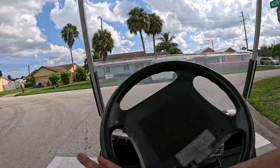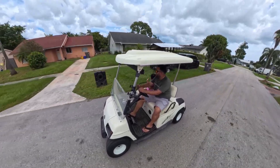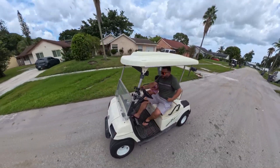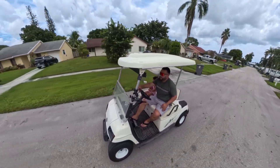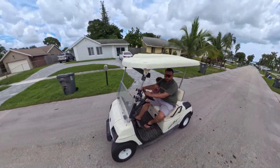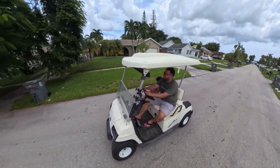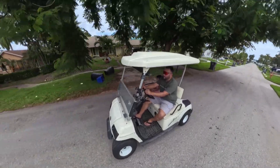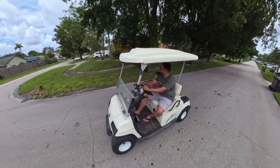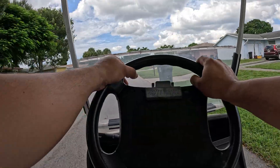Something super awesome about lithium batteries is how much less they weigh. I took at least 320 pounds away from this golf cart and just added about 55 pounds, which is what this battery weighs — that's a huge difference. Even when I had the Yamaha G29 with the 105 amp-hour lithium phosphate battery, that one was about 65 to 68 pounds, and it still made a big difference over the lead-acid batteries.